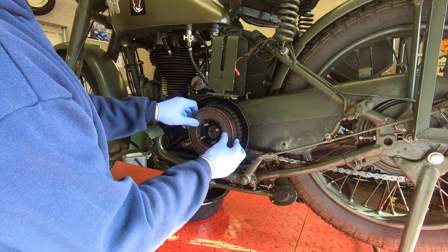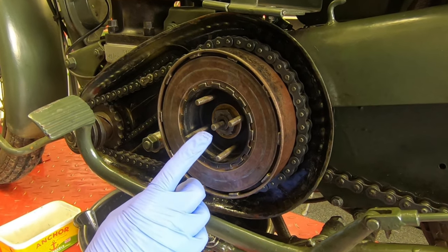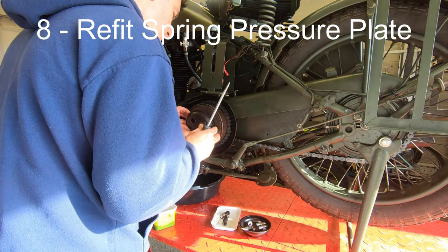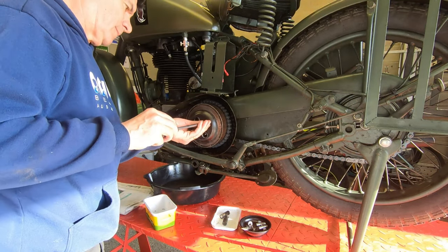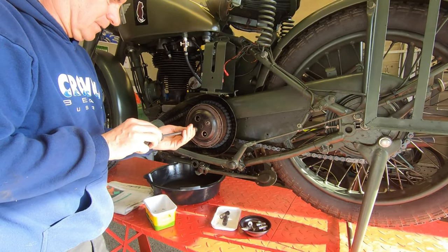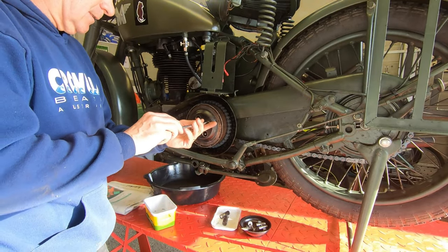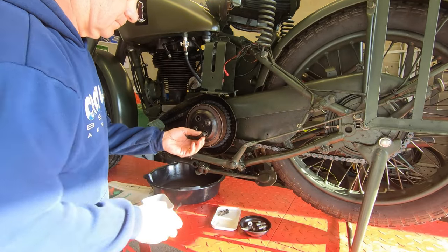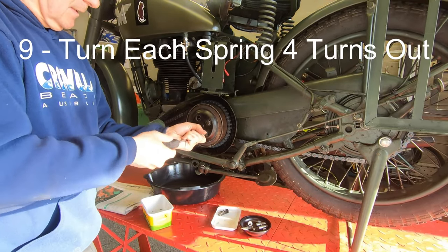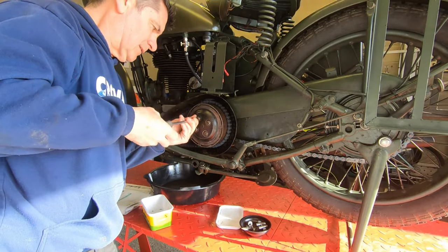Because of the way the clutch works — if you look into the center of the clutch here, you'll see the operating rod. With my left hand out of view I'm just going to gently pull the clutch lever in; when I do that you will see the rod come out, and that's what pushes the spring plate and disengages the clutch. Now we'll put the spring pressure plate back on — locate it so that the clutch rod just goes into the dimple right in the middle. Make sure that you've got the steel cups in each of the four holes, then put the spring in and you can start with the flathead screwdriver because you get more leverage on this than any special tool or pincers. Get all four in and then start to tighten them up — the idea is that we tighten them fully home as far as they will go, and then undo them four complete turns anti-clockwise. When you do that the spring tension preload is exactly right and then we can start to adjust the clutch from there.